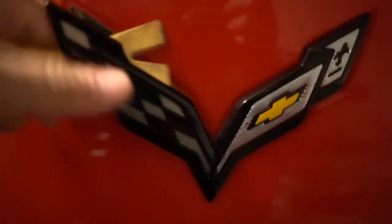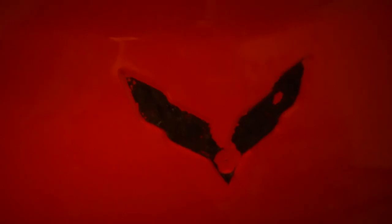So first thing: I have my extension cord. I'm going to use my heat gun to de-badge these badges and use one of these yellow plastic trim tools to take them off. They come off pretty easy but they leave a whole bunch of glue — this stuff is kind of hard to get off, coming off in layers, almost like styrofoam. I'm going to let it soak in Goo Gone and then remove the front one and come back to this one.